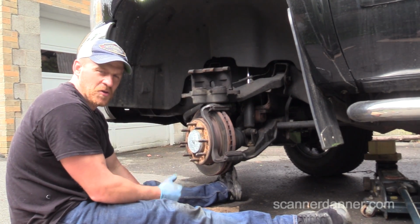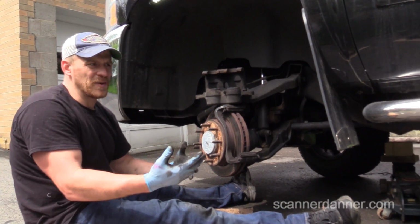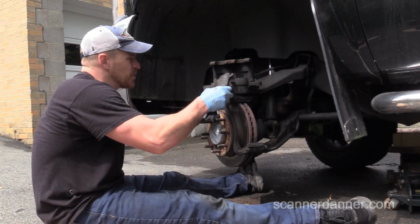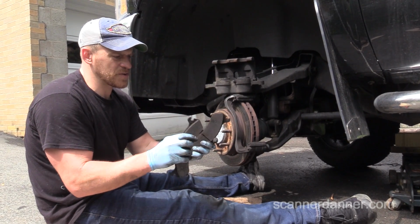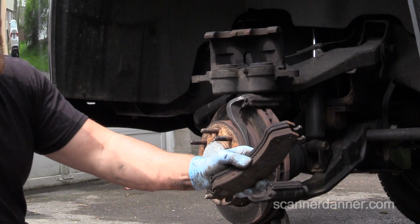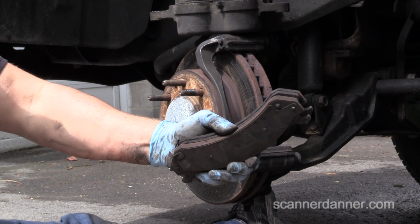I don't think we need to show the push on the brake part. This piston's frozen. Now what we need to do is check the right front too. And this would explain the heat cracks in the pads. This would also explain the thickness. We've got sunlight now, Caleb. Look at the thickness difference in those pads, right? And that is again from that one piston hanging up.